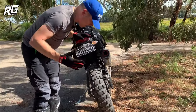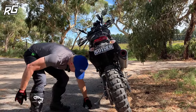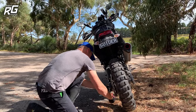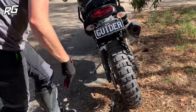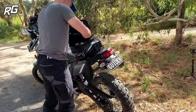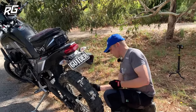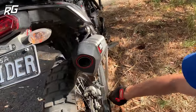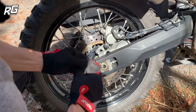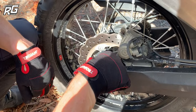Come around to the back of the bike and you can see the angle of the tire we're dealing with — this is the problem that was quite rightly pointed out. Don't judge me on the tire; that's getting swapped in a couple of days — one very tired tire. We've already loosened the nut so I'll back it off a bit more. Now I'll put my little spanners in here and crack off the chain adjuster nut, back it right off, then move it in to give us the adjustment to take the wheel off.